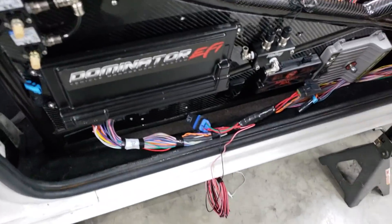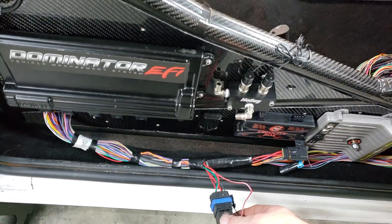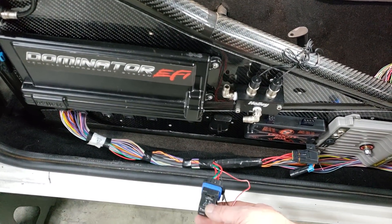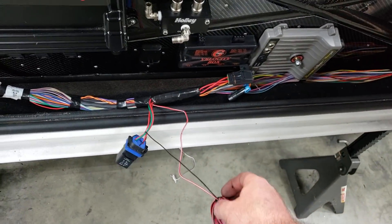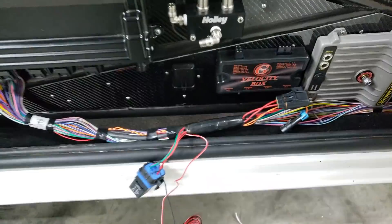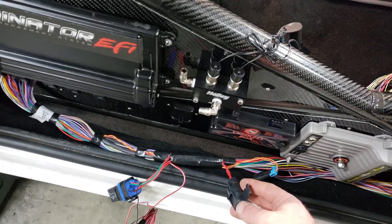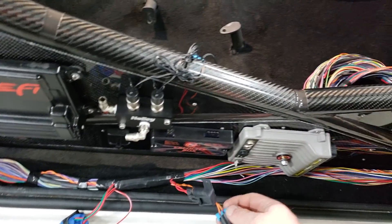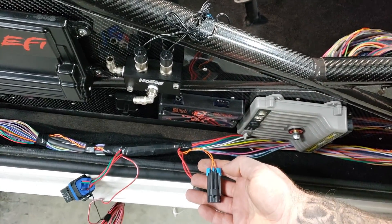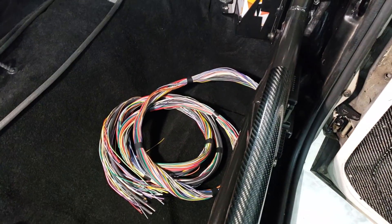Something I'm going to show you is on my own car. The relay is already in the harness. For my application this isn't ideal because I don't need this relay — I'm running a mechanical fuel pump, and if I had an electric fuel pump I'd be triggering it off the smart wire. But this is good for 99% of people doing a custom wiring job. There's already a fuse built in, your CAN bus plug is already terminated, and it's about 20 feet long so you can put this thing wherever you want.